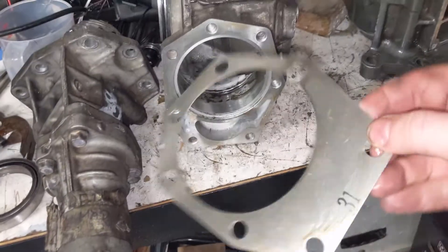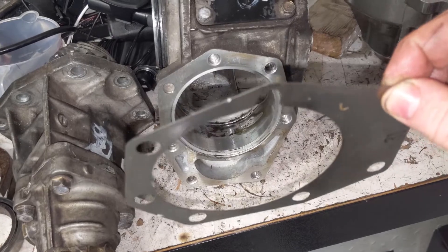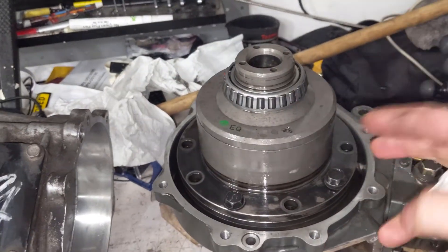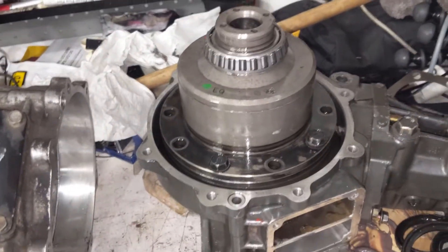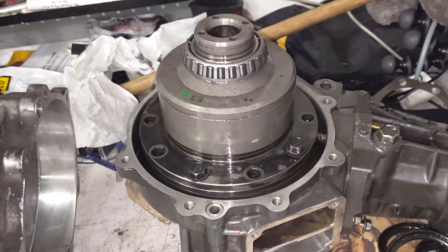When shimming this, if you don't have a bunch of these lying around, they're really hard to get hold of. If you happen to just take your transfer case apart to fit a new diff inside — like an LSD — don't worry, it's not going to affect the shimming. But as soon as you mess with that ring and pinion gear, replacing it or whatever, then you need to reshim it. And these parts are not easily come by.